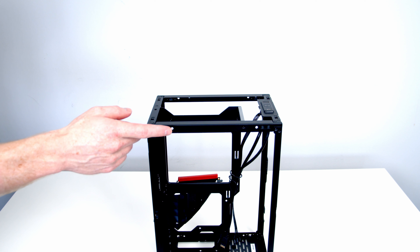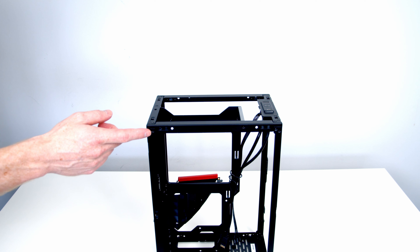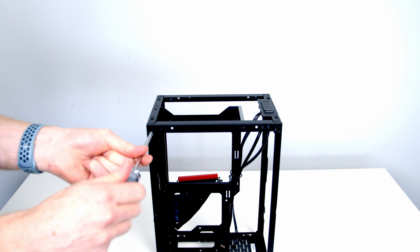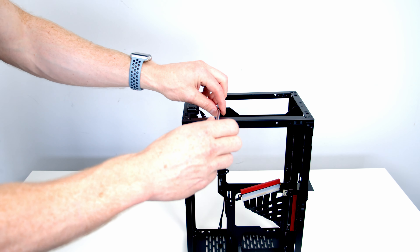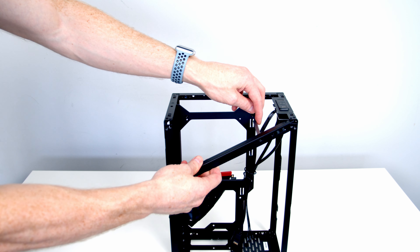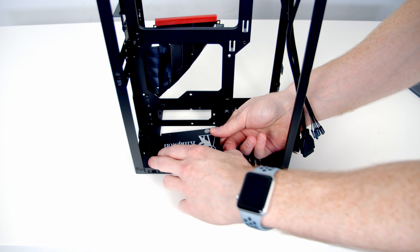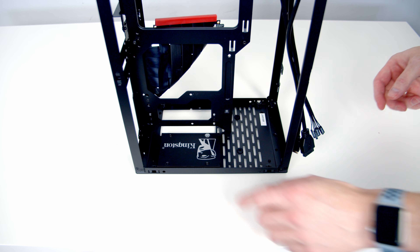To make the building process a little easier we can remove the front frame on the motherboard side of the case. There are two screws at the front, two at the top on each side, and an additional screw at the back behind the metal bar. With all the screws removed we can slide the top frame down and away. At the bottom of the case we've got rubber mounts for installing SSDs — we can install two SSDs there, lining them up and screwing in from the bottom.